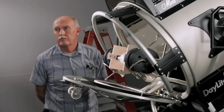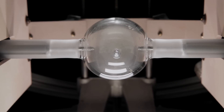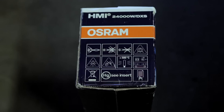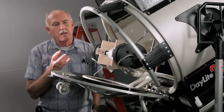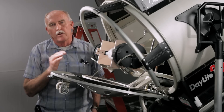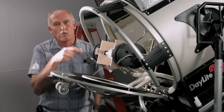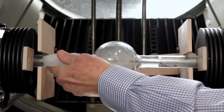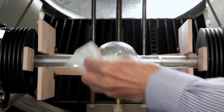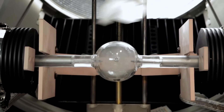Bill, I noticed you touched the bulb. Yeah, we've been touching the arms. What needs to be done is — alcohol wipes are supplied by the manufacturer in the box — you need to wipe off the entire globe and the arms. The reason is that oils from your fingers on quartz glass, when it heats up, will actually eat into the glass itself. You'll see your own fingerprints, which eventually destroys the quartz. That's why they insist you use an alcohol wipe and wipe it down.